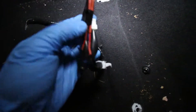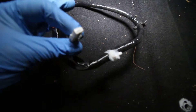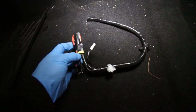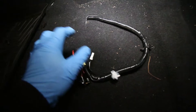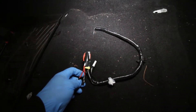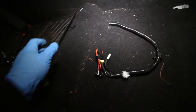So this is the harness for the seat belt buckle switch — that's the SRS unit that detects when you're buckled in. And this is the side airbag. I have soldered and heat-shrunk stock OEM-like pins into the stock harness so it's easily removable. That way I don't have to cut into my side airbag harness, so if I ever want to sell the car and put the stock seat back, I don't have to source another airbag or damage the stock wiring.